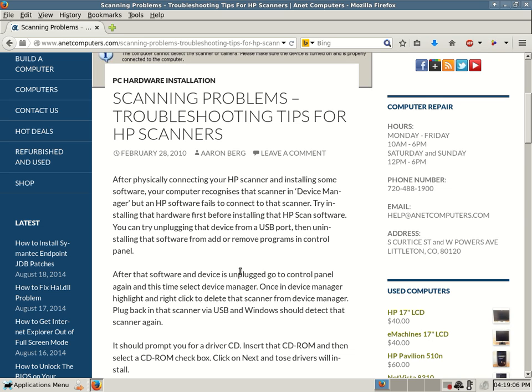A lot of devices I've noticed it's reversed, but it just depends on the model number. That's why you want to go through your quick start guide or setup guide. If you don't have one, you can go out on the internet and look for one — but you would need your exact model number. Let's say you have an HP ScanJet 7640C, you Google that. Find out what kind of device you have and whether you hook up your device first. It's very important because if you don't do it in the proper procedure, your scanning device is not going to work.